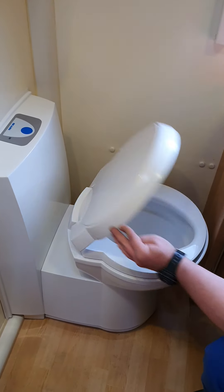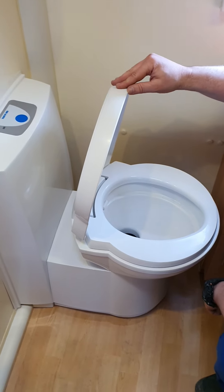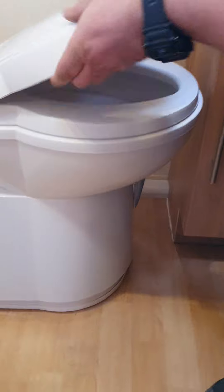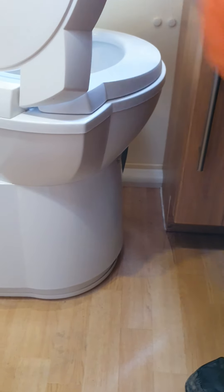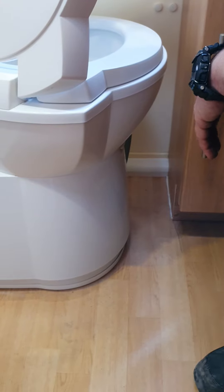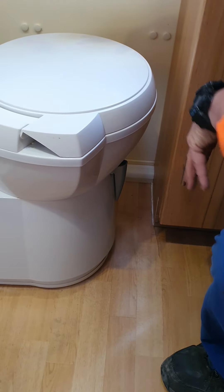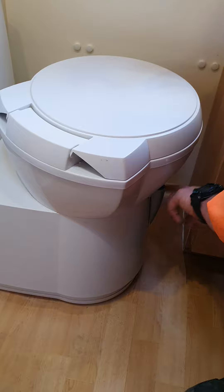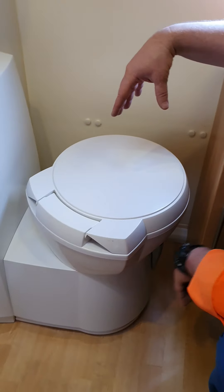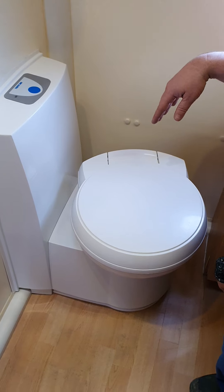This is the inside part for your toilet system. That lifts up — you've got your little blue flush button, so press that to flush into the bowl. Down under here, rotating the bowl a bit, you've got your wee grey lever — push that and it opens up into the waste caddy, then you can use the blue button to flush everything away. Once you're finished, slide that back around and that closes off the waste caddy. If you're going to remove the waste caddy on the outside, make sure this is pulled back in the closed position, as the waste caddy is only designed to be removed with this closed. If you do find it's not coming out, just come and check that. The bowl does rotate, so if you've got long legs you can move that around to fit in there easily.